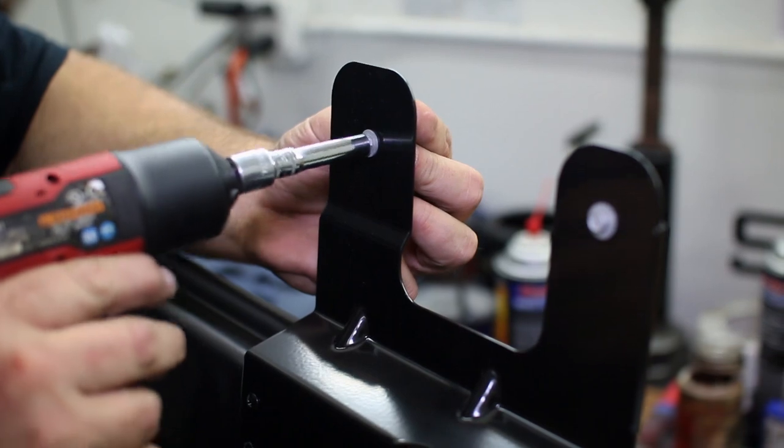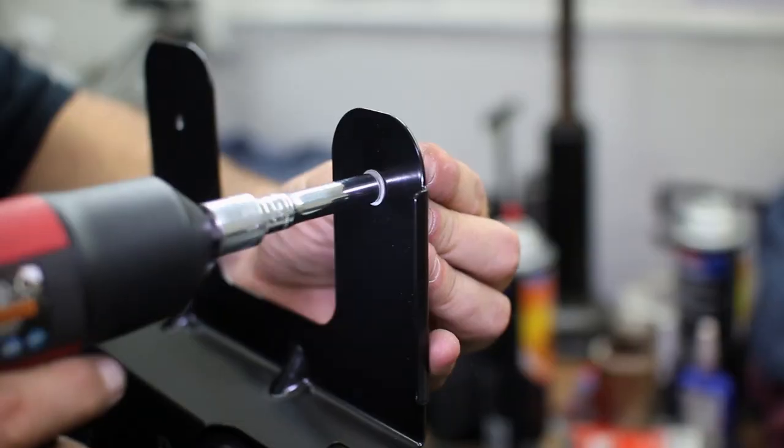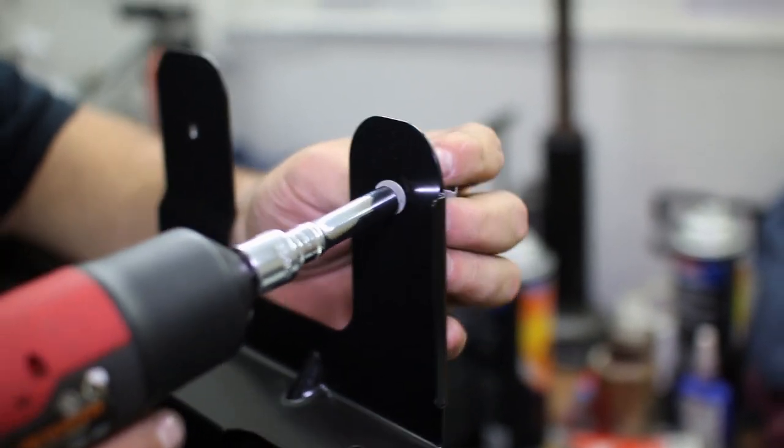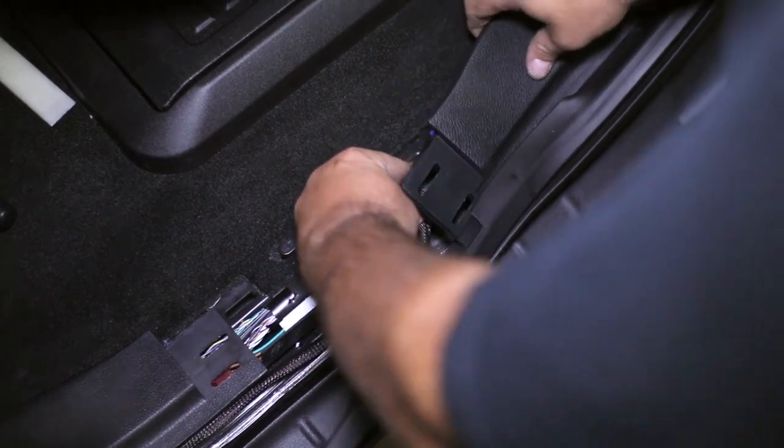Back to the new sub — remove the two screw clips and screws from the replacement subwoofer mounting bracket. These are only used for trucks not originally equipped with subwoofers. Then preparing to drop in the new sub, we hid the wiring harness under the kick panels and snapped the panels back into place.